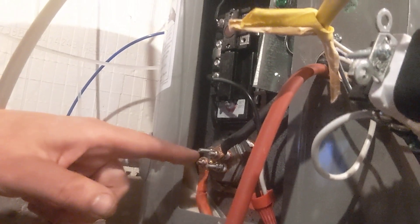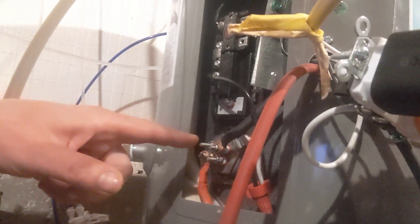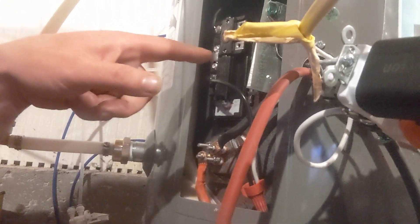So what I've done is kept the thermostat at 110V because I have a 110V heater. I removed the heating element — it's right here, it just unscrews with a little gasket — and a new 48-volt heating element from Amazon is about $30. That got screwed in. So the thermostat here is wired 110V just like you normally would, but instead of the other side of the thermostat going to your heating element, it doesn't.